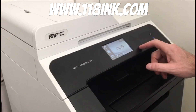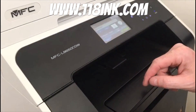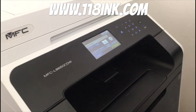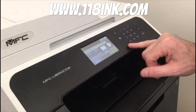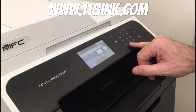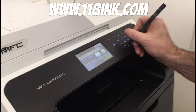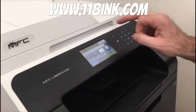To reset the toner levels, press Fax, which brings up this menu. The only reason we're bringing up this menu is to see where this star is, because in a second we'll go back to the home menu and these lights will go out with no impression left. So just put a little mark so that when the light goes out you'll know where you are.